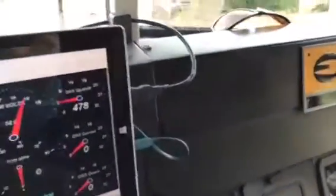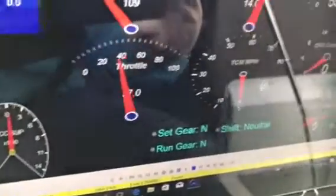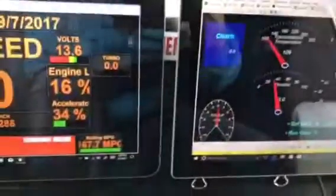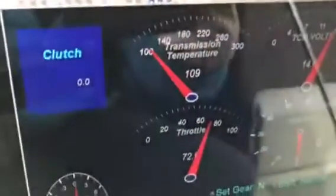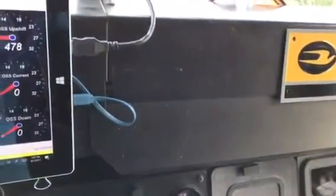Now our throttle — we got throttle! I still have my little pedal sensor hooked up, however my throttle matches now at 34%. I'm going to erase it. I don't know if this will work when the engine is turned off or not — let's set it back to just 'on' and see if the ECM will talk. It does!